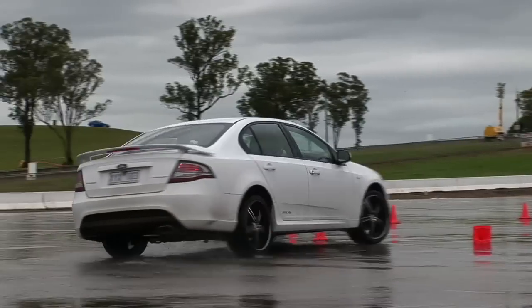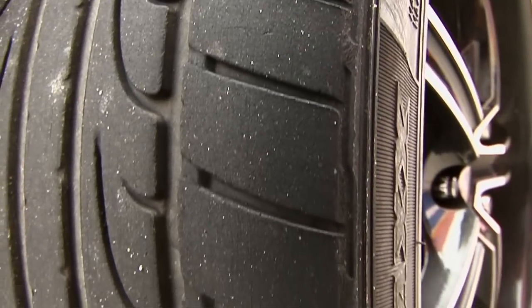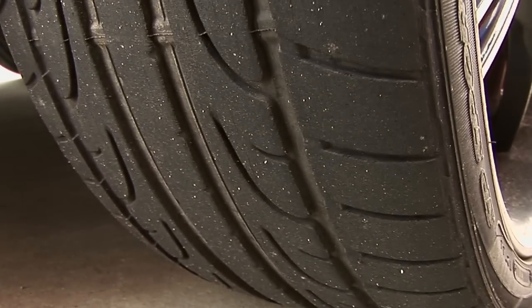The message really is be careful when you're looking at your tyres. If they're down to the wear bars, which we'll also look at as part of this programme, then you really need to replace them straight away. Make sure you've got plenty of tread on your tyres, because that's all that is pumping the water out from under your tyres on a wet road.